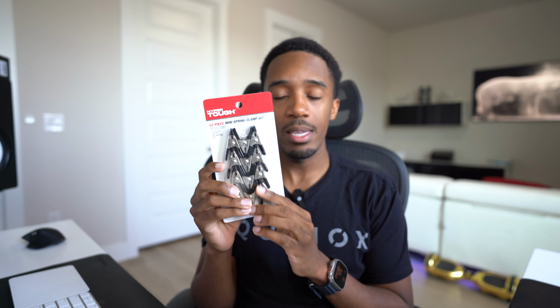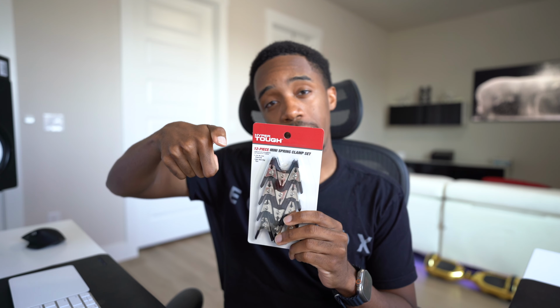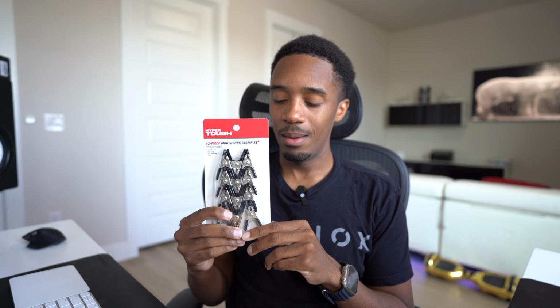Now this is more of a nice to have. You don't need this, but having these mini spring clamps, which I picked up at Walmart for like $5. I'll have a link in the description box if you wanna check out the same or a similar thing on Amazon. This is so that when you're laying the headliner down and you're waiting for it to dry, you can clamp it down just so you can ensure that everything is staying in place, especially if you're configuring other sections of the pillar or the headliner. These clamps help. You don't need them, but it is nice to have. I didn't use them for every piece, but then when I did start using them, I liked them. Work smarter, not harder. Next, you need the 3M Super 77 glue.